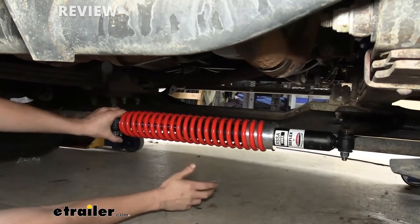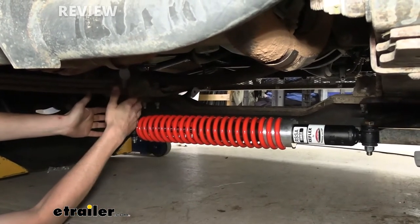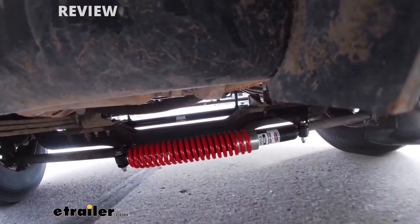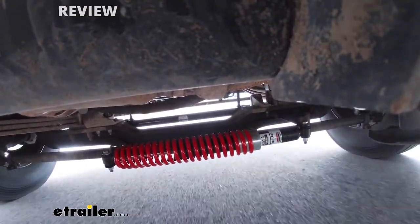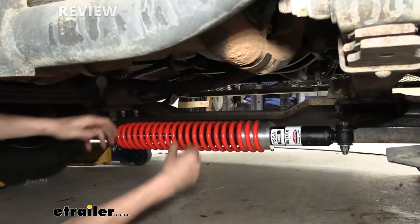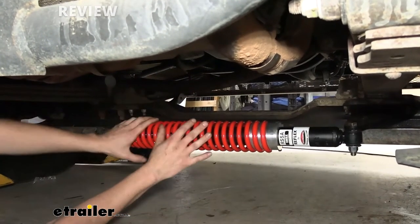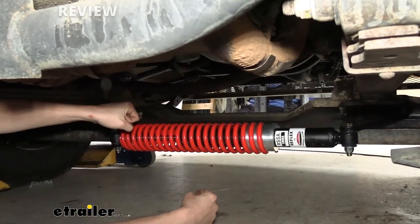It is clamped down in this position and our wheels are both straight. If we were out on the road and go to turn to the right, this bar would actually move to the left, angling the wheel right and stretching out the spring. Once we want to return after the turn, your caster on the suspension system might help a little, but a lot of these motorhome suspension systems are really a bear to work with. With this stabilizer in place, as the wheel goes back, the spring is actually pulling it back straight for you.